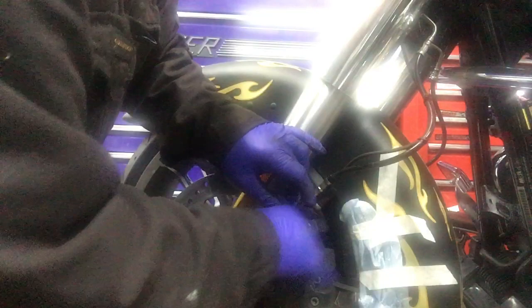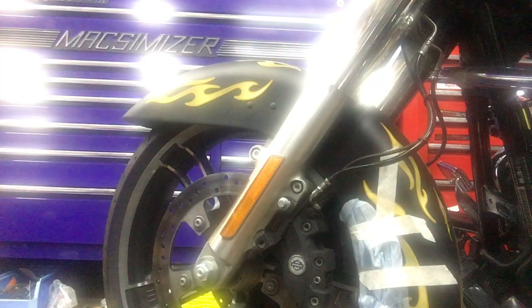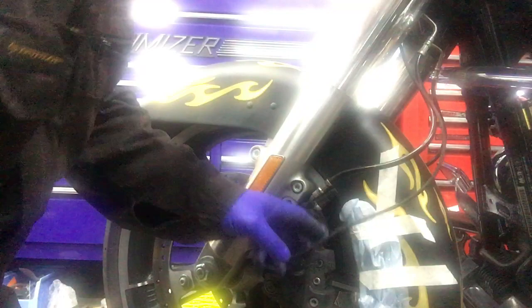On this particular bike you can see the ABS is tie-wrapped to it here, so that means we've got to cut those tie wraps. Just grab a pair of cutters — this is only on this one side. So basically we're going to cut these off, then pull this caliper off. Okay, set the bolts aside.